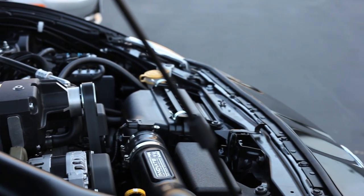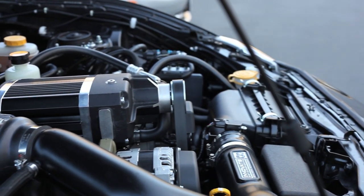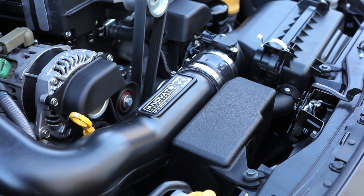This car is a 2013 Scion FR-S. It has an Innovate Supercharger kit — actually the upgraded version of it. It has a 69 millimeter pulley and also has the Laminova intercooler core that's been put into it.